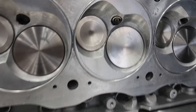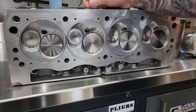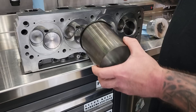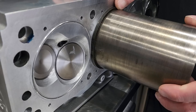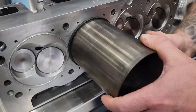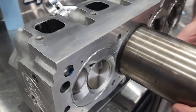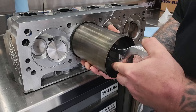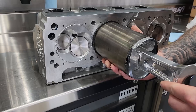This is a cylinder head and I've got a spark plug threaded in here just for representation. Ignition timing is the amount of degrees before we reach top dead center that we start the fire — the spark plug is what starts the fire. What I've got here is a sleeve out of that engine we were just looking at. When this is all bolted together, the sleeve locks in and sits there, and then you have a head gasket, a piston with a connecting rod attached to the crankshaft. The engine is pumping, going up and down.